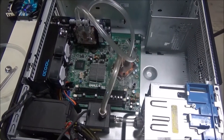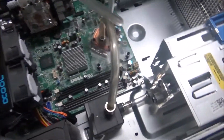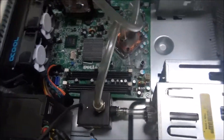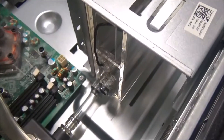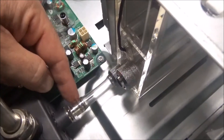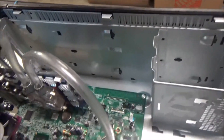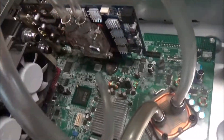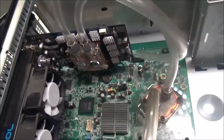I've been putting some parts in off-camera because starting and stopping the camera just wasn't working for me. I've got the reservoir in the front like a normal drive bay, and I've hooked the bottom reservoir up to the pump. This one has a regular compression fitting; this one I'll put a hose clamp on. It's going to pump water to the CPU block, then to the GPU, loop around and go in right there.